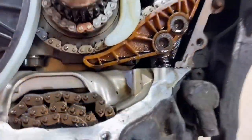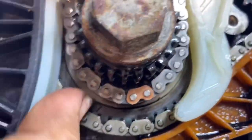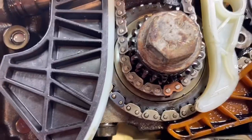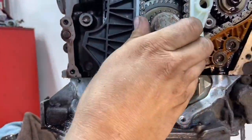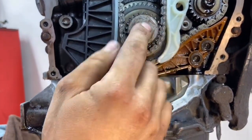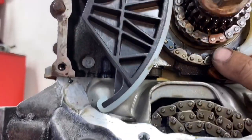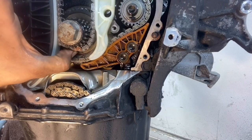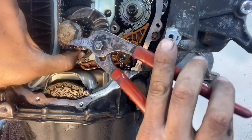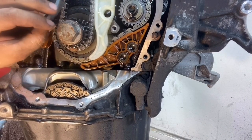Guide is sitting there — let's look at the bottom. At the bottom we're going to have a little tiny triangle that the brass link is going to line up with. It might not be perfect — you might have to spin the crank a little bit. This might be a little bit difficult if you don't have this bolt tight enough, but you can take a pair of pliers and gently spin this gear. So this is the part that people often fail at. This little tiny triangle has to be perfectly lined up, and then there's often slack in the chain, so you have to locate that little tiny triangle, pull the slack out of the chain, get all the slack on the timing chain side over here, and then just let that sit right there.